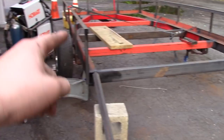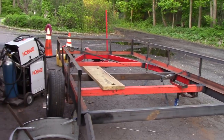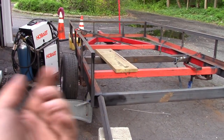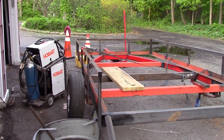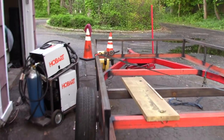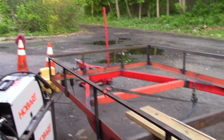I did get the taillights and I got an ID bar. I've got to get lights for the fender, and I'd also like to put a corner light on either side up front. I'm doing a 7-pin trailer hitch connector because my taillights have a reverse light feature - how often do you see trailers with reverse lights? With the 7-pin you also get a constant 12-volt power supply and one for your marker lights, which is better than a 4-pin. And if I ever want to add brakes, I have that 7-pin connector ready for it.